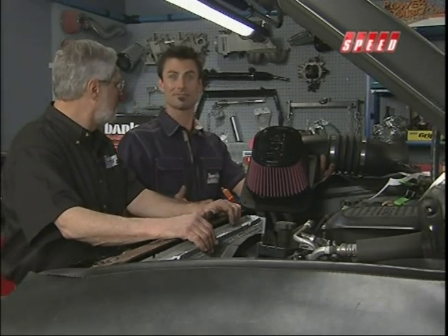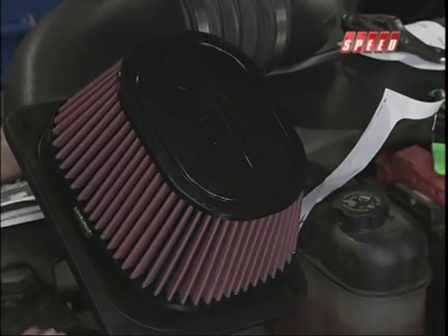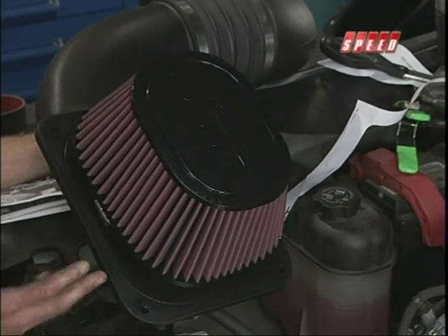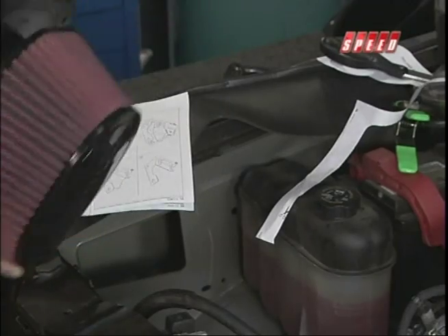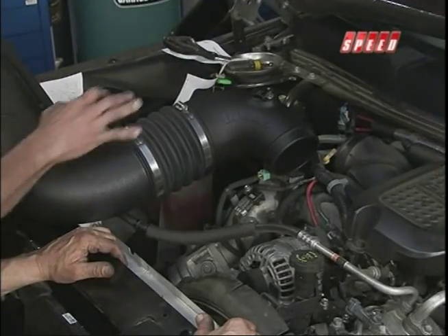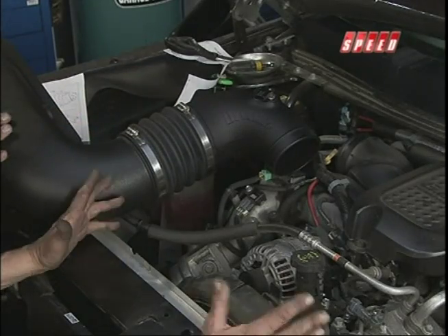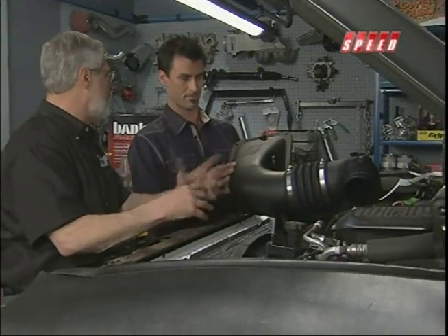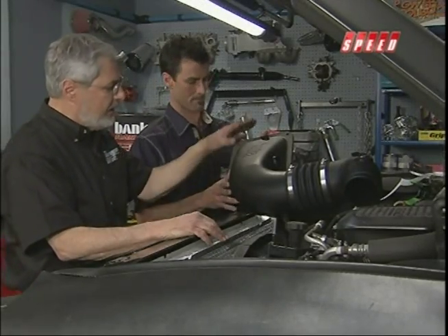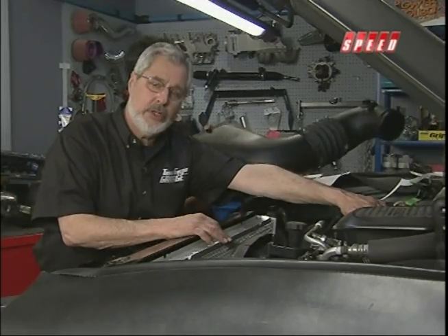What's the difference? Well, if you're making 10 million vehicles like GM does, a few dollars saved here saves them a lot of money — but it doesn't help performance. This is a high-quality filter made for performance. And you can see, just like on the intercooler, this has nice swooping bends and easy airflow, whereas the factory may have used cheaper, easier-to-manufacture pieces with all those crazy mufflers sometimes to keep it quiet. We're going to pull outside air through the air filter — nice and clean — down into the turbocharger.